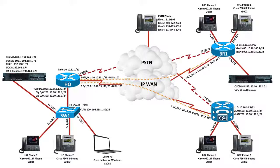At the HQ site, we've got Switch SW1 connected via a trunk into the HQ router. Connected off of Switch SW1, I've got a Cisco 9971 IP phone — all of my 9971 phones in the topology have cameras installed — and a Cisco 7965 IP phone. I've also got a server running VMware, virtualizing a Communications Manager publisher, a subscriber, a Cisco Unity Connection server, a Unified Contact Center Express server, and an IM and Presence server.